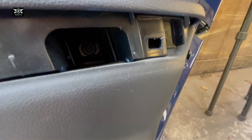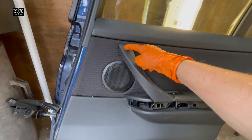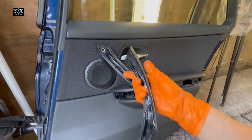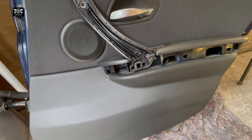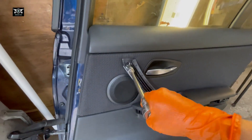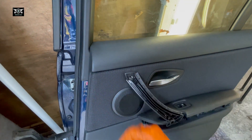There's one there and one there — I've already undone those two. The next step: once you've loosened those two, there is one more Torx screw in here inside this pocket. You could get something like this in there to try and pop this open, and then it's just plugged in there, so you can undo that Torx.